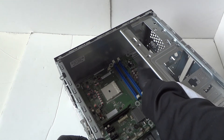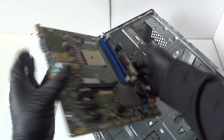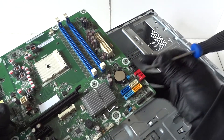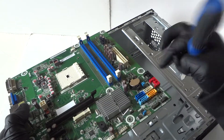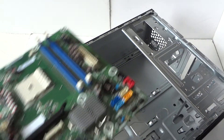After removing all eight screws, take your finger and lift up the motherboard and it comes right out. The last part is removing the CMOS battery. There's a little clip — take a flathead screwdriver, press on the clip, and the CMOS battery comes right out.